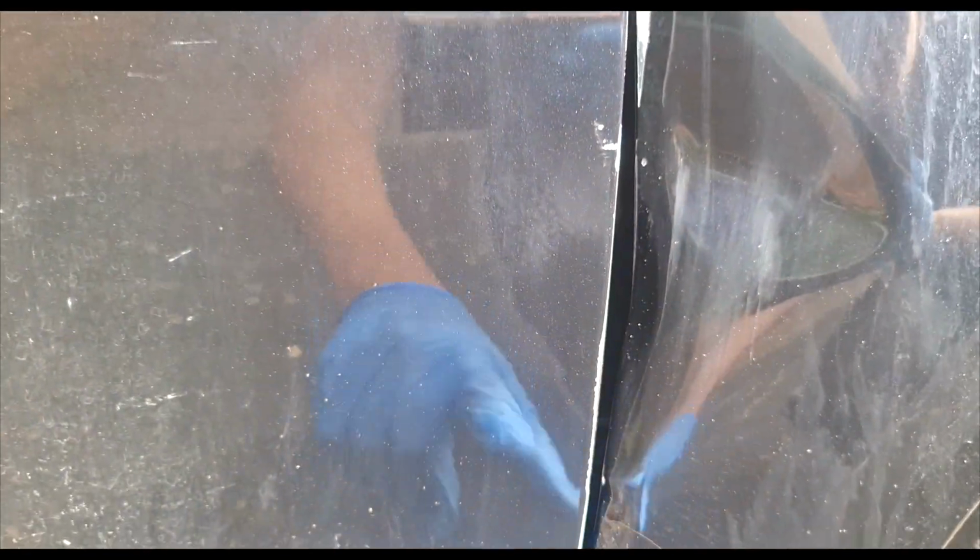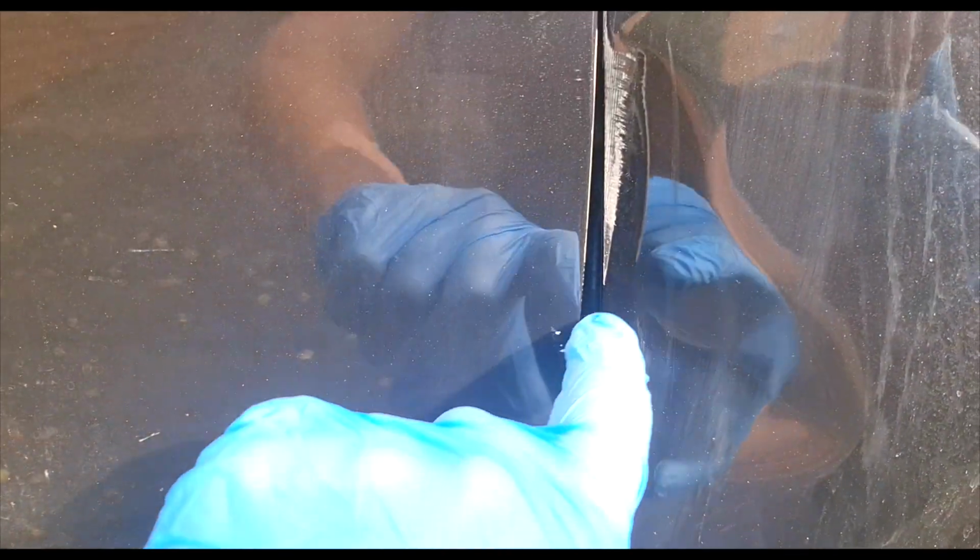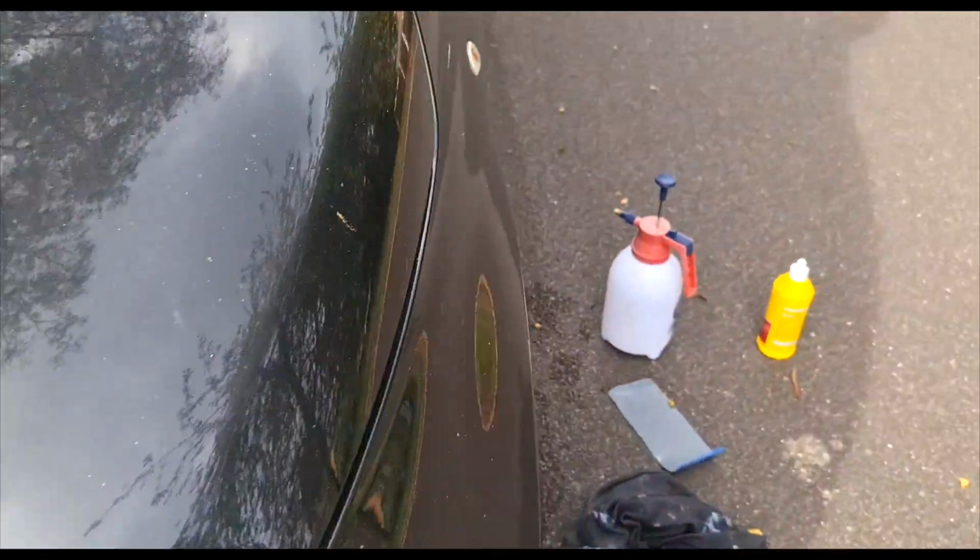So luckily, and I thought it was going to be a paint job, this predominantly has come out with just some very good abrasive compound, and actually it's taken it pretty much off. I've sanded the lacquer back as well, just to go through that layer of lacquer and polished it back up. And apart from these corners, which are just going to get touched up with a bit of paint, I was really chuffed with that.